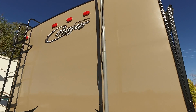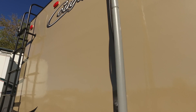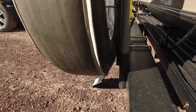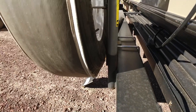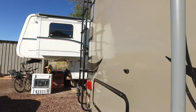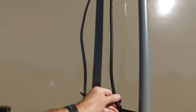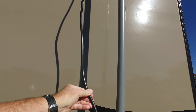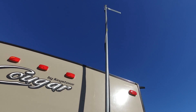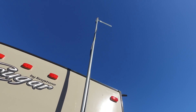The mast is from Radio Shack — it's just three five-foot poles. I had it welded to the bumper, and it pulls apart so I can store the five-foot poles in one of my storage lockers. Then I have regular cable — actually it's the thicker coaxial cable, which has less signal loss — running up to the antenna.